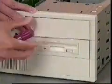A drive bay is the area, or bay, that holds a drive. It may be used to hold a floppy drive, hard drive, CD-ROM drive, or other device. You will usually find a vacant drive bay near the floppy drive. Once you have identified a vacant drive bay, you will need to take the faceplate off. Since every computer is different, you may need to consult your computer's owner's manual to see how this is done. Many faceplates will simply snap off. However, some will need to be unscrewed. If there is another metal bracket blocking the entrance to the drive bay, take this off as well.